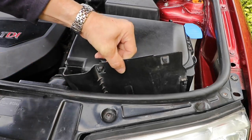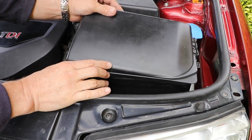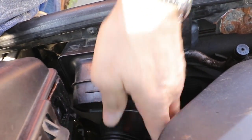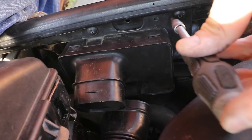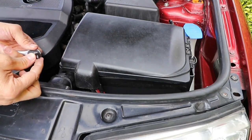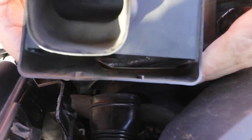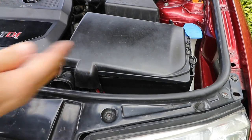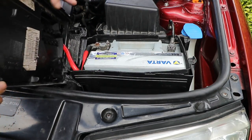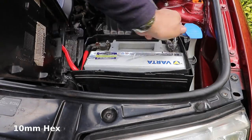Remove the little black plastic access panel at the side of the battery box — that hides the securing bolt and bracket for the battery. Then take the intake pipe off and the little vent bracket at the front, which helps you lift the battery box cover away from the battery so you can get easier access. You don't have to do that, but it's only a couple of minutes' job and it makes it a lot easier. Lift the lid back. Now you can disconnect the battery — make sure you disconnect the negative lead off first.